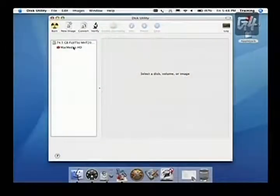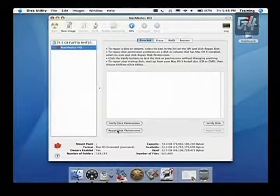So you might have your favorite, but there's a million of them. Let me see the ones you really like, because you do this all the time. I do all the time. So every Mac comes with Disk Utility, which is Apple's. If you're going to run any system update, the one thing I suggest is to repair your permissions before and after any major update. Disk Utility comes with every Mac, it's in your Utilities folder. You launch it, it'll show the name of your hard drive, you click on the name of your hard drive and you click Repair Disk Permissions. This can fix so many problems, like printing issues, network issues, this one little thing.